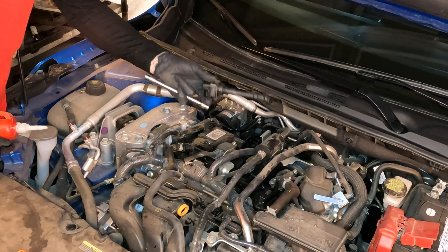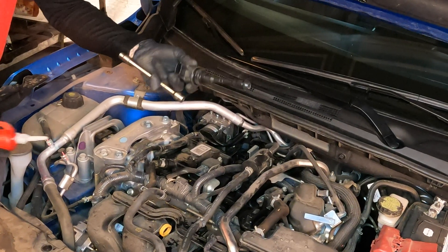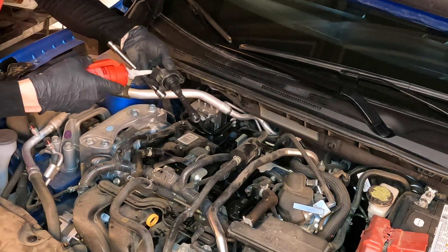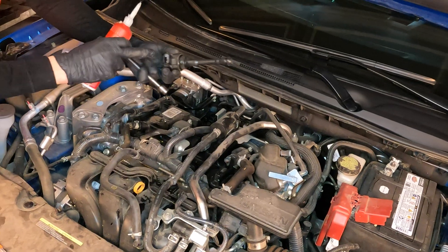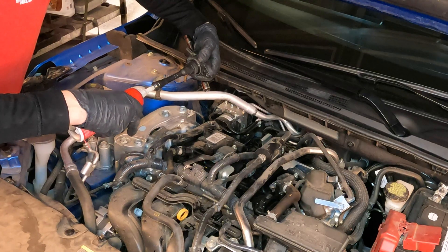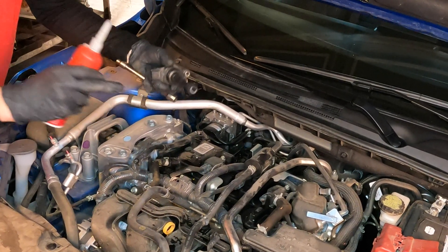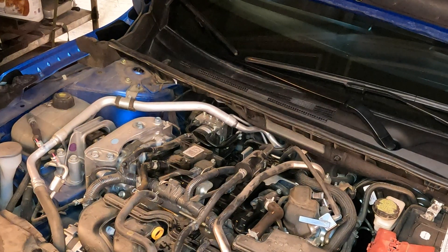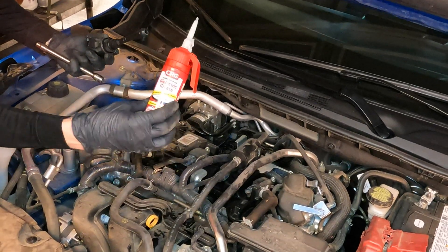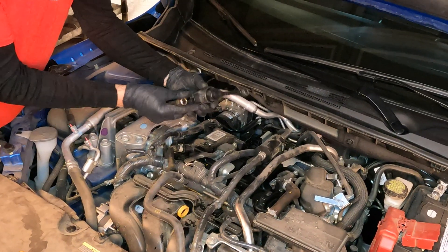When reinstalling your electrical components such as the ignition coil, I like to add a little bit of dielectric grease. Put some dielectric grease inside the connection and some in the spark plug boot just so moisture stays out of all the connections if possible. You can find a link for dielectric grease in the description below. Got everything lubed up.